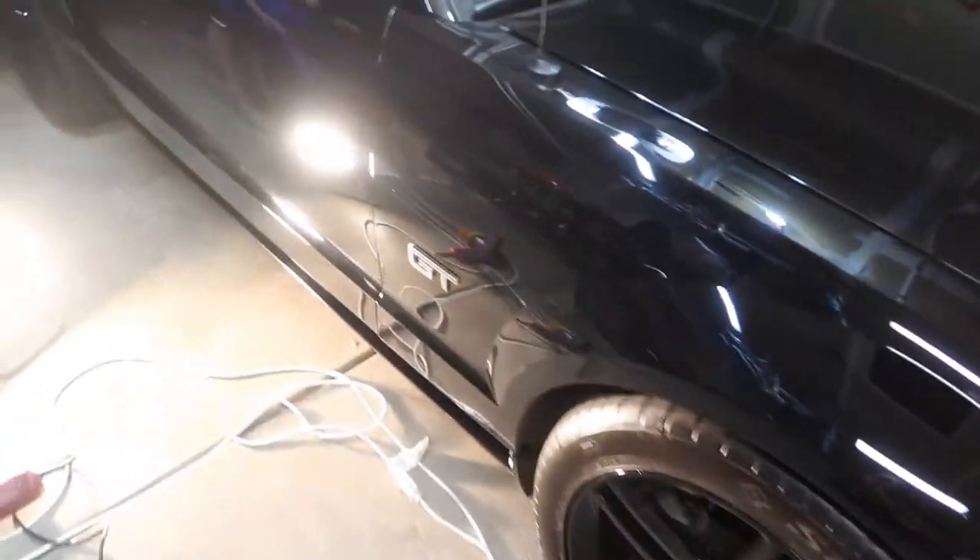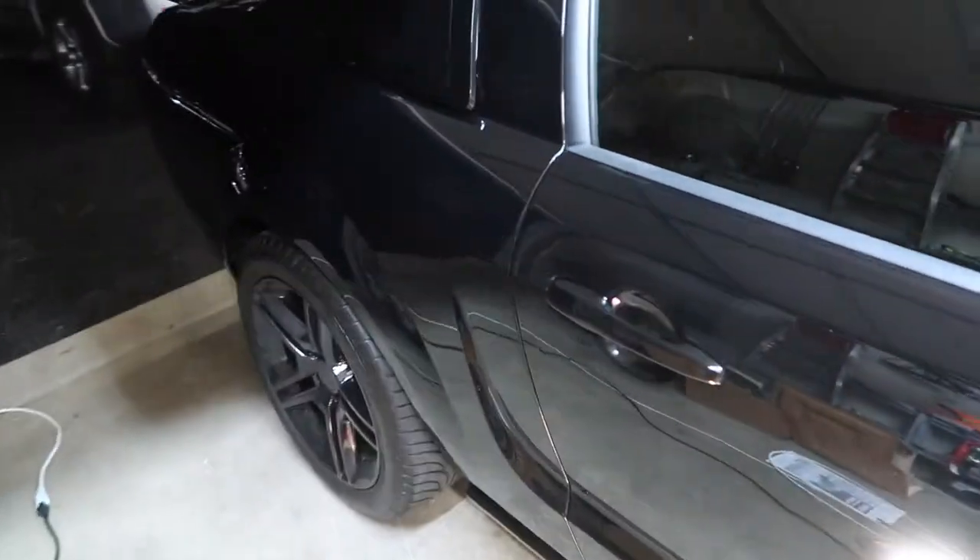So we just finished using the correcting, cutting compound - whatever you guys want to call it. It came out really nice. If you guys take your time and follow everything I'm saying, you're going to get great results just like I have so far. My paint is literally looking like glass - it is literally like a mirror. So now we're going to go over the car with the light, walk around, and see if there's anything we missed before we head into the finishing compound, which will remove any very minor swirl marks or scratches. The cutting compound is used to take out the deeper swirls and scratches. The finishing is more just to touch it up and take care of things you missed that aren't as bad as it was originally.